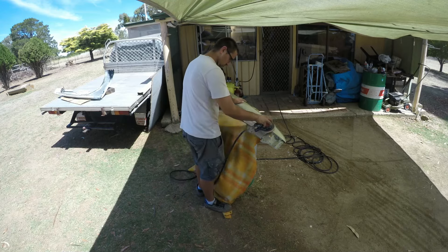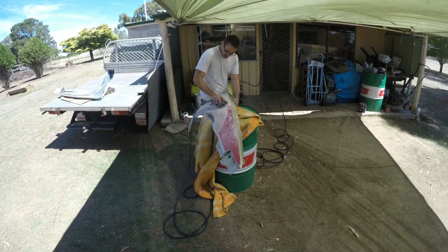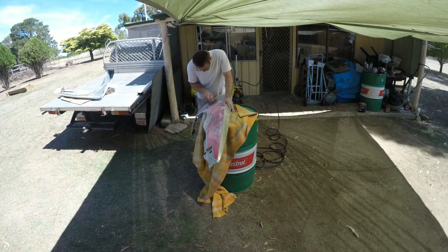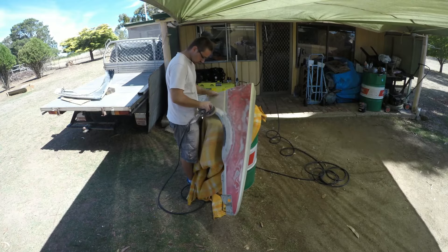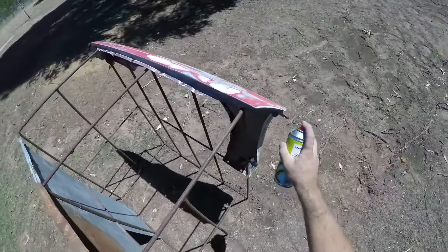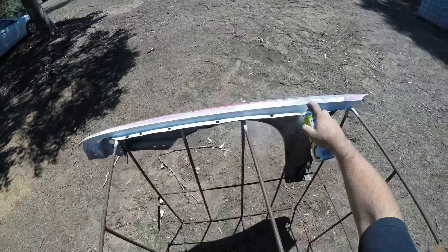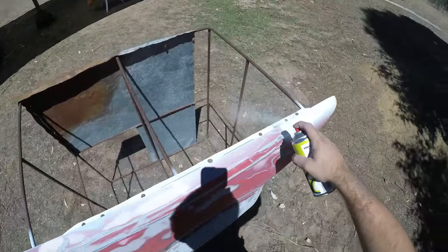I did the same process with the driver's side guard — just a rinse and repeat like I've been doing on the rest of the car. This one was actually painted in a two-pack — like a gold two-pack — and it was quite thick. Unlike the acrylic that I wanted to take off for being low quality paint, I wanted to take this gold paint off just because it was so thick. It was pretty cool to see that this guard was off of a red car — with a secondhand guard you don't know what you're going to get. Just like the rest of the car, any time I cut through to bare metal I made sure to seal it up with 1k primer to protect it from the elements before finally sealing it up with a proper epoxy primer.